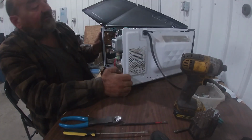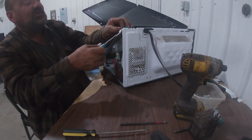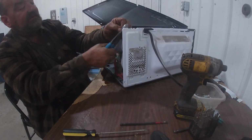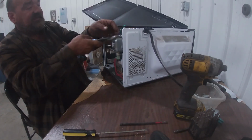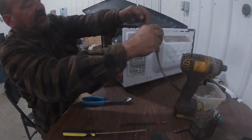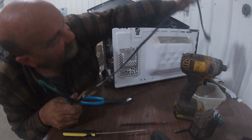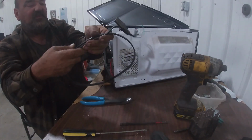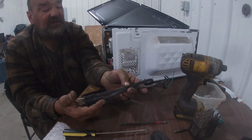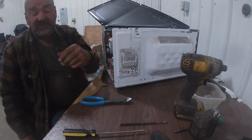So, first thing I will do is grab the power cord. I want to cut the two grounds up here, and then cut the power cords as they go into this small circuit board that pulls through. And at my yard in Bloomington, if I cut the ends off, they call it number two insulated copper. I leave the ends on now, and my local yard calls that 40%, which is the highest that they do.